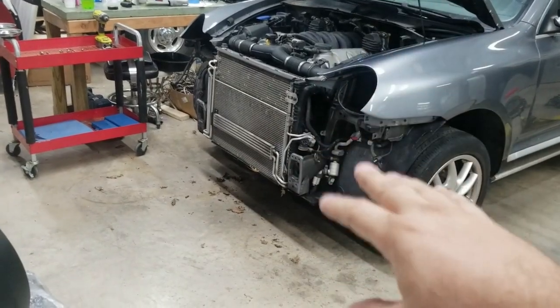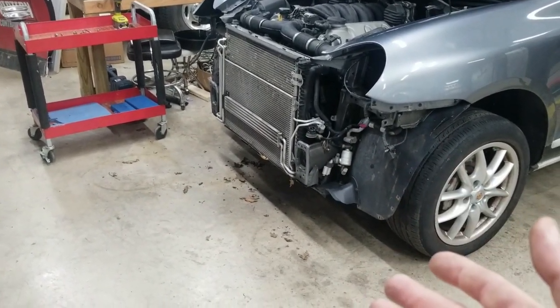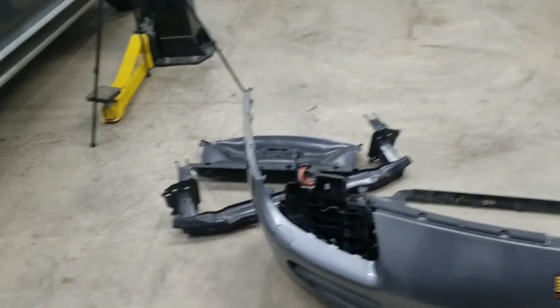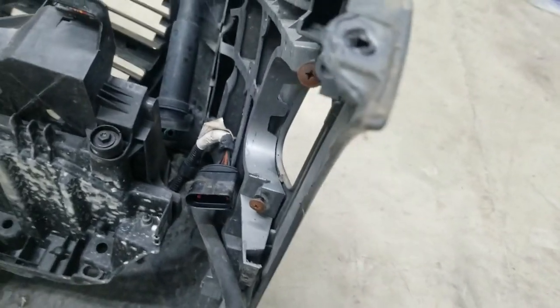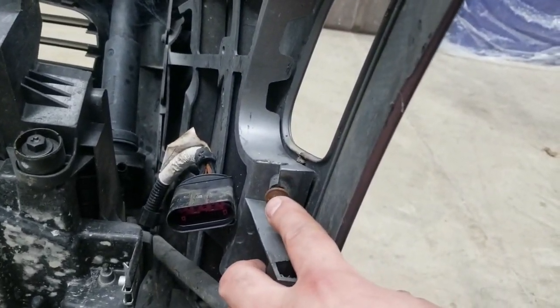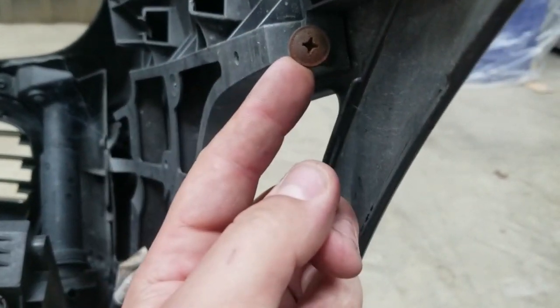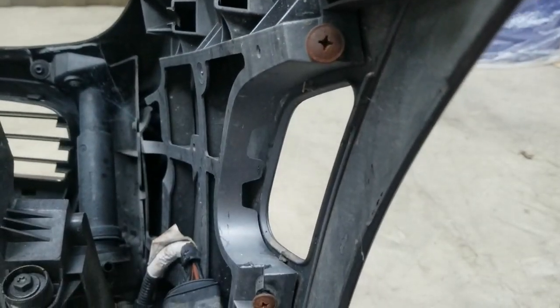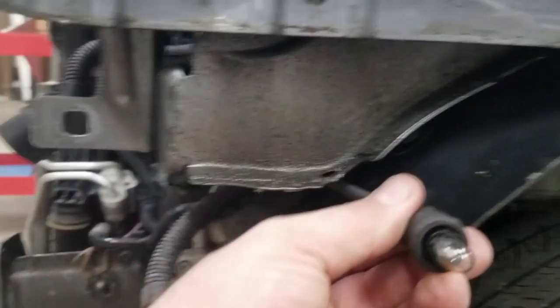I didn't want to make a video on how to take the bumper and headlights off — if you can't figure that out, maybe you shouldn't be trying a timing chain job. But Pelican Parts has great write-ups on a lot of this service, not specifically what I'm doing, but bumper removal and everything. One thing I'll add: the turn signal markers — you do not need to take them off. The Pelican Parts write-up says to remove the turn signal, but both screws need to come off. However, just leave them in place, reach in and unplug the wire. That's all it is — it just plugs in, you should be able to reach in there and unplug it without removing the markers.